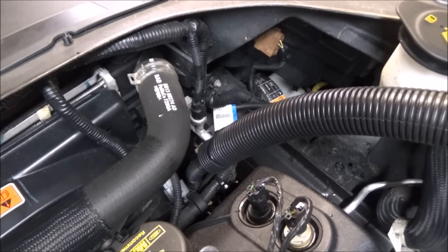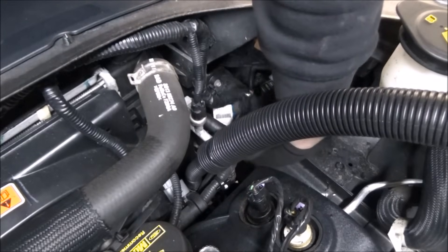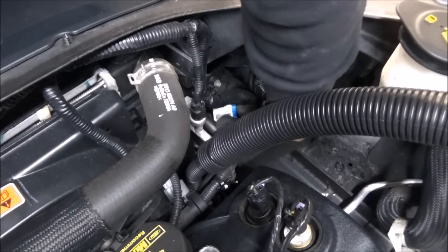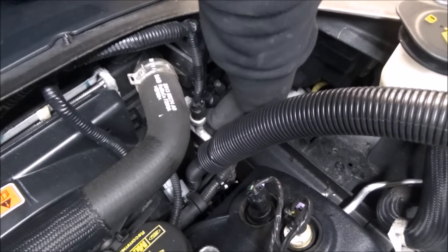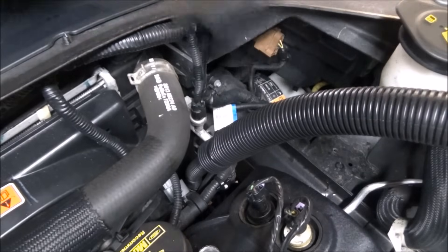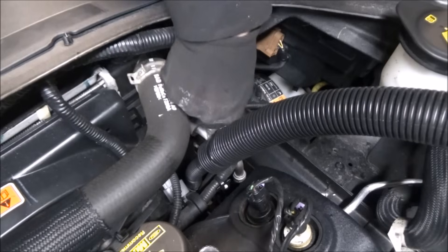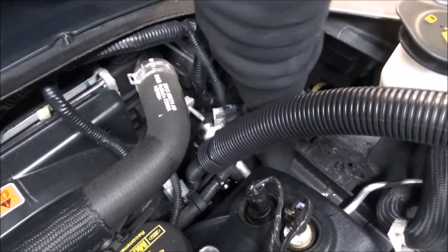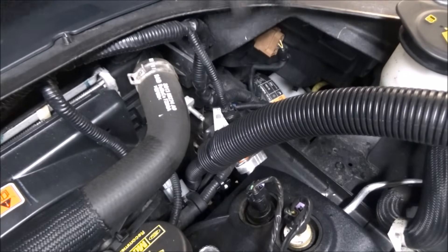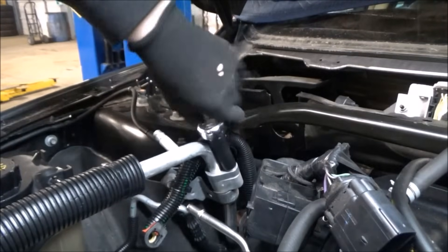I have not disconnected the AC lines yet, basically because I was pretty late in reclaiming the air conditioning. The best place to disconnect them is at the condenser — it's very accessible and easy to get to. Just one nut to get off and then the AC pressure sensor. You want to fold this line up out of the way so it doesn't get snagged on anything when we lift the chassis up. The other easy place to disconnect is right here — pretty much a no-brainer. Just get that off and get the line tied to the engine.